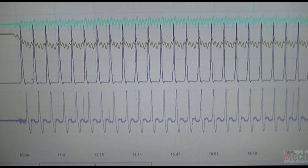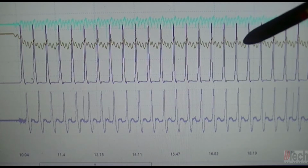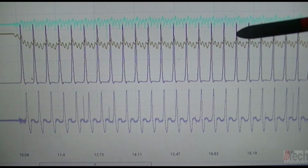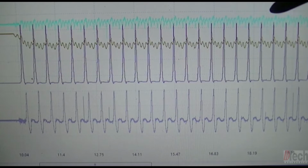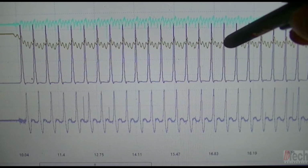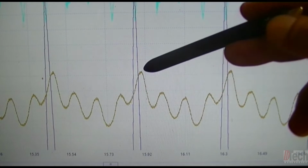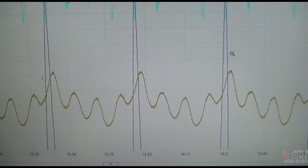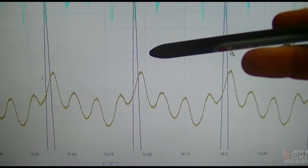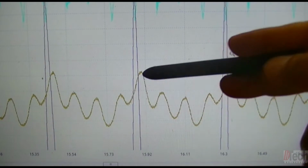Okay, and here we have a capture of the vehicle with the anomaly on the intake trace. And I have in cylinder 3, in cylinder 1 intake trace, and then this one here is exhaust trace, which I'll explain that one later. The thing that we are concentrating on, or I want to explain, is the things that can make the intake trace go up. We have the possibility of high positive pressure being introduced into the intake manifold from a leaking intake valve can cause the pressure to rise and cause an anomaly in the trace.